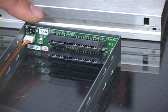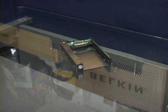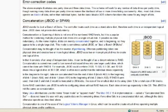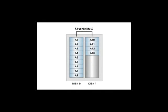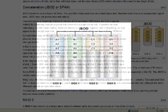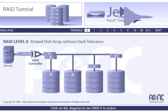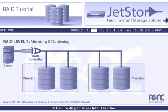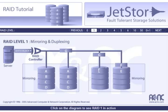The RAID level is set by a pair of DIP switches, one on the carrier and one on the frame, either of which can be used to tell the Dataport 25 which RAID mode you wish to use. In mode 1, the drives are concatenated, meaning you will get one single visible drive that is twice as large as the smallest drive in the array. In mode 2, the drives are set for JBOD — just a bunch of disks — which treats each drive as an independent hard drive. Mode 3 is RAID 1, Mirroring, which gives you two copies of your data for maximum protection. The last mode is RAID 0, or Striping, which distributes your data across both drives, maximizing transfer speeds, but also giving you a single point of failure. If one drive dies, you lose everything.